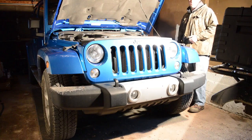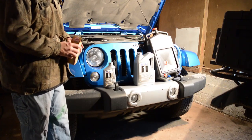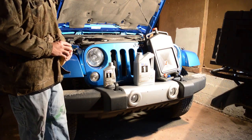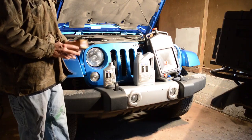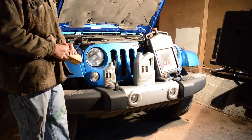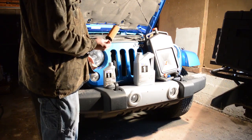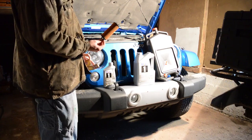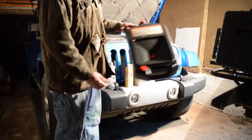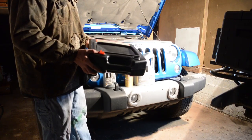This will make the oil drain faster and make our oil change easier. Before beginning, you need to make sure that you have the proper tools and parts available. Obviously for an oil change, you need oil — the Jeep Wrangler runs on 5W-20 motor oil. I'm a Mobil One fan myself, so I purchased Mobil One oil. STP filters were the only ones available in my area due to a lack of supply recently, so I picked up an STP filter. It's interesting to note that the Jeep uses a cartridge filter, which is a little bit different than your stereotypical spin-on filter. You also need a way to collect the oil — I picked up a waste oil storage container from my local Harbor Freight. You just slide this under the car when you drain the oil; it makes it easy to dispose of and deal with.